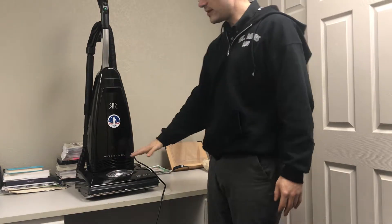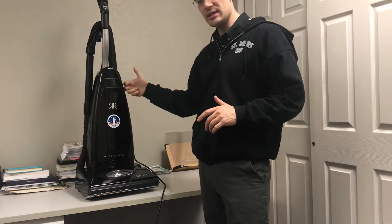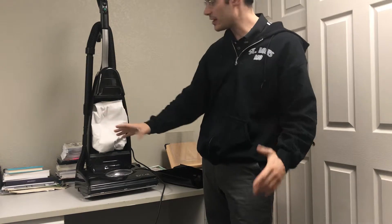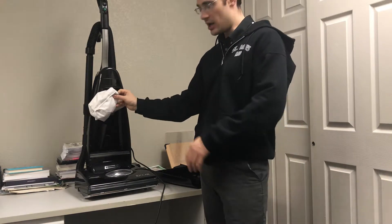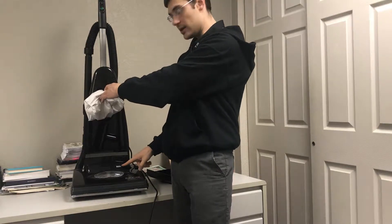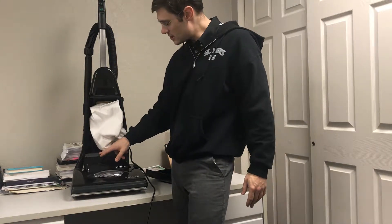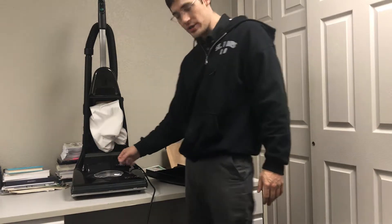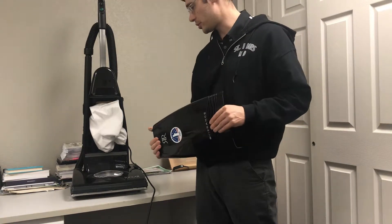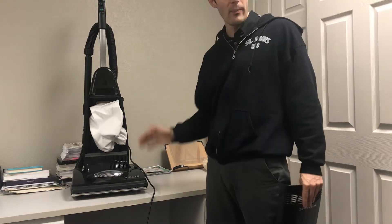The vacuum cleaner has a motor inside. The majority of vacuum cleaners on the market have what's called a bypass suction motor system — the motor takes air up through the tools and into the dirt chamber. Once debris enters, it goes into a bag or, if bagless, into a dirt cup. The air then processes through a pre-motor filter before going out the exhaust. The exhaust also has a post-motor filter. All bypass vacuum cleaner systems have some sort of pre-motor and post-motor filter set.